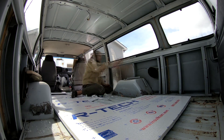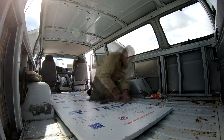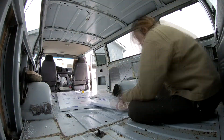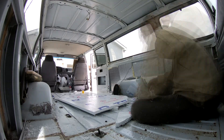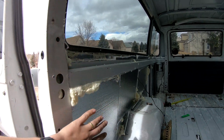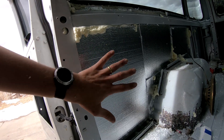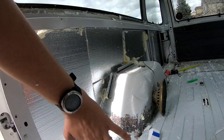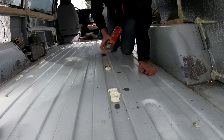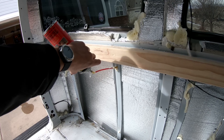It's solid — it's not going to let any moisture in or any cold drafts in, which is what I want to avoid. For the majority of my insulation I'm using foam insulation — it's very lightweight and easy to work with. I've got this side done, so there's two layers: two inches of foam here and then up here it's just one inch because that's all that really fits. It's not the prettiest, but all I'm worried about is getting either styrofoam or foam in every single nook and cranny, because this is all going to get covered up anyway.